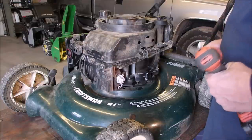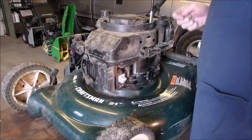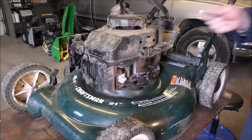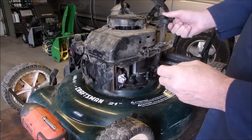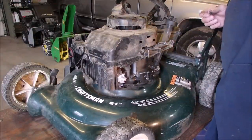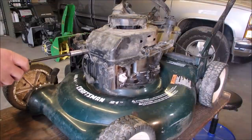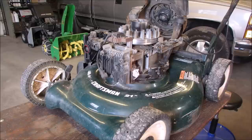Let's just do a thing here. This is a Quantum 101 we're in here. We need 3-eighths now. We've got to get the dipstick off. And then there'll be four 3-eighths bolts. My buddy David Kernut suggested checking the flywheel key. Let's just pull this off. Fifteen-sixteenths — that's weird.